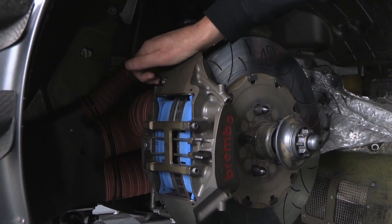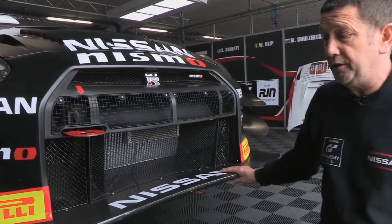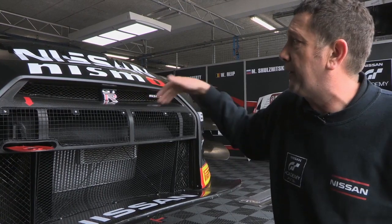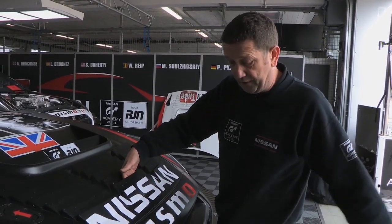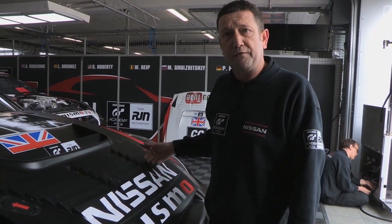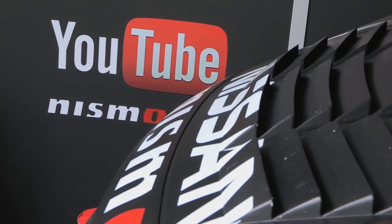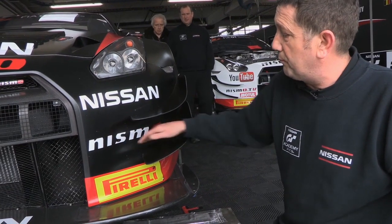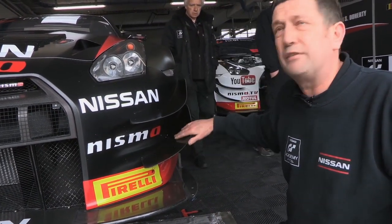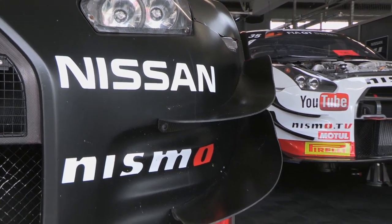Another really important piece of the car is the aerodynamics. This is your front splitter, and then coming up to your engine oil cooler going up through the top there, and this is the exhaust side coming through the different coolers, releasing the heat from the engine. Above that on your front bumper, you've got the 2013 front dive planes, which give a lot more grip and downforce across the front end of the car.